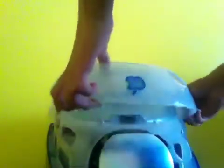Okay, now after you've done that, you'll have to lift the case from the bottom, down here. And if your iMac hasn't been open yet, or it's been open a couple of times, you might hear a plastic sound, like plastic breaking. And it does no damage to the outer case — it's just a little click or a pop that means the case came off. So really, the sound of plastic breaking in this case is good, unless you actually broke the plastic.